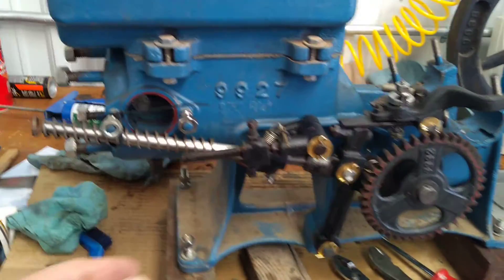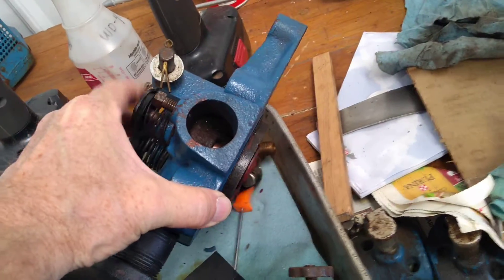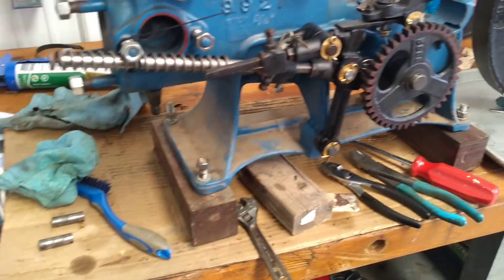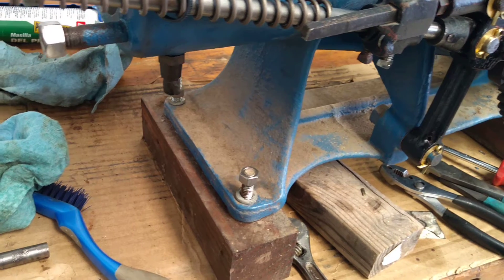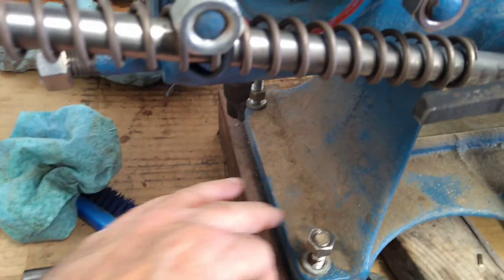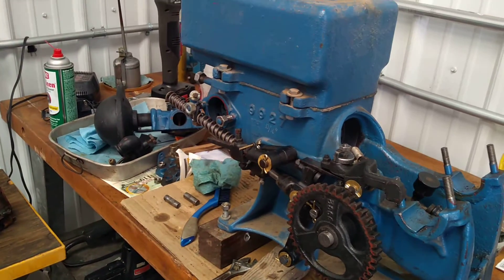Making progress. My goal today is to get ready to get the head back on. I'm going to lap the valves a little bit before I put that back on. And of course I've got to give the body of this thing a good cleaning — you can see it's sat in a shed for a number of years and it's covered with good old Arizona gumbo clay dust, stuck on there like glue. Then I'll get this crankshaft set in the saddle — that needs to be cleaned up yet too.